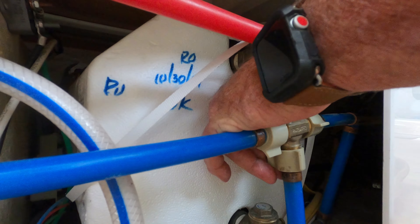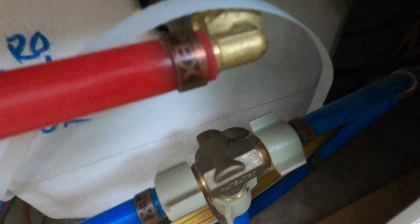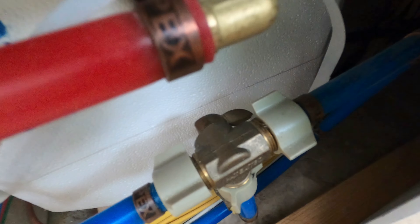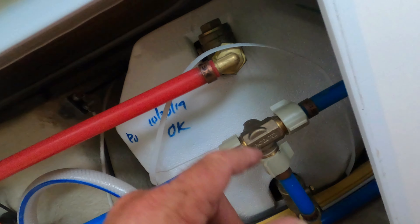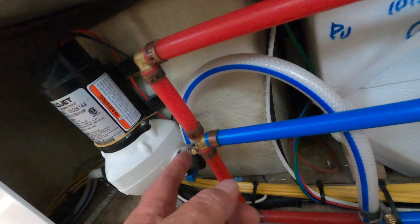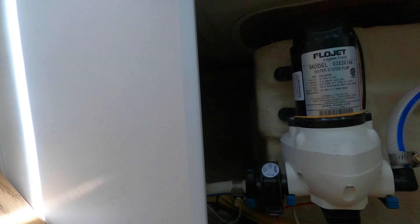The first step is going to be just like we did when we serviced the water heater — flip the little valve on the back side so that it's horizontal across those pipes, and that's going to bypass your water heater. Normally water comes in this tube, goes down through the blue one and into the back of the water heater. When you flip the valve it sends it straight across into the red lines, which are your hot water lines. That's how you bypass the water heater.